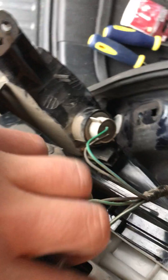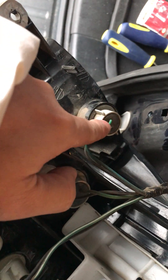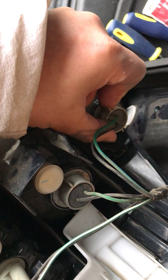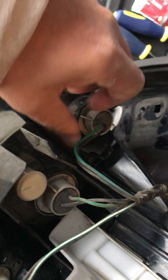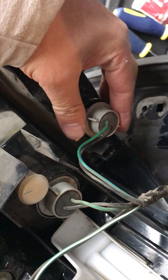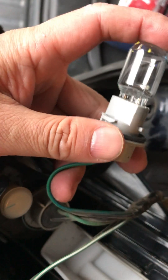If you look at the wires, you see this one is the top one and this one on the bottom. This one is, I think, the brake light bulb. What you need to do is just rotate it maybe about 30 degrees and you can take it out and replace the light bulb.